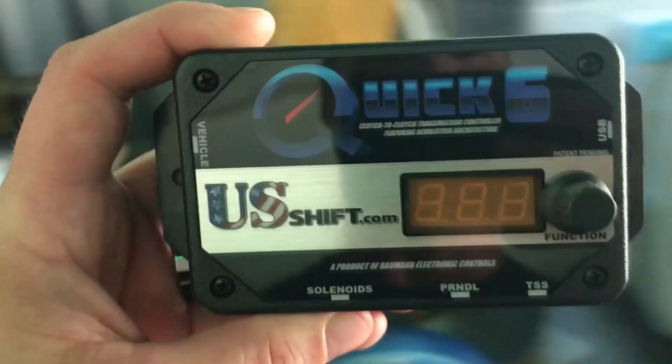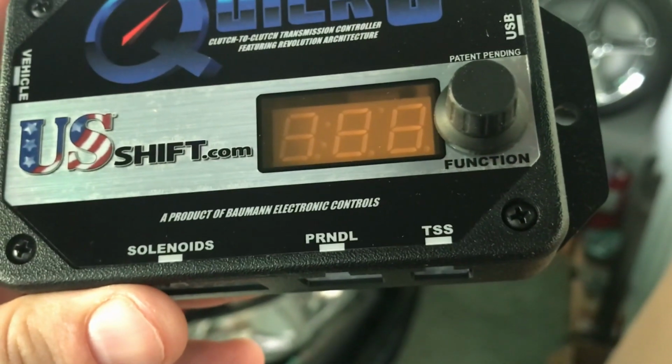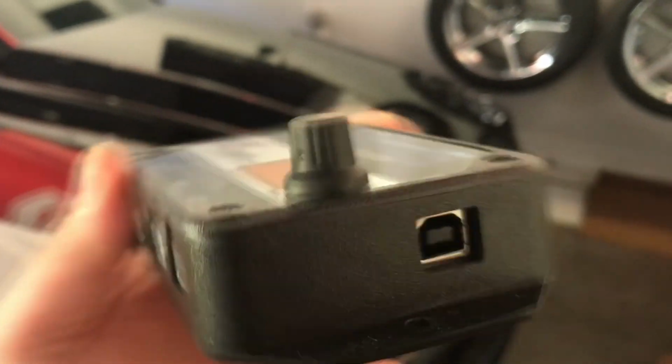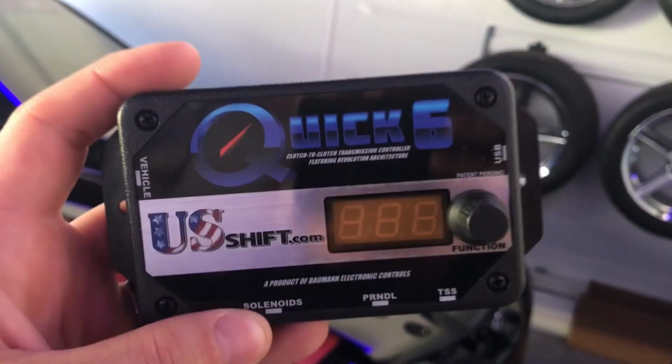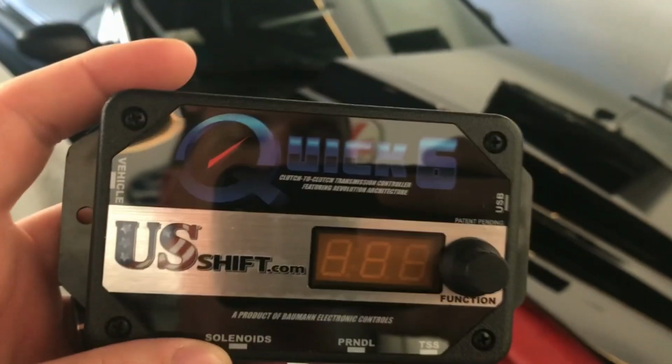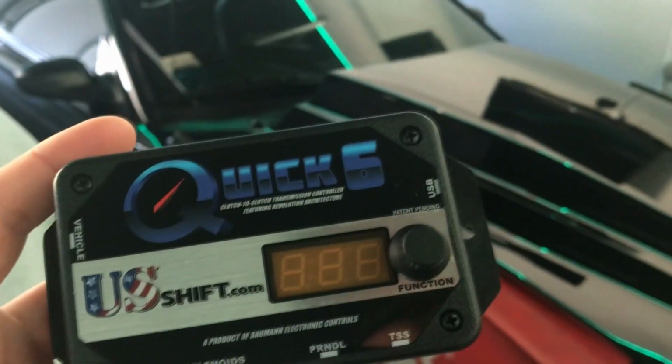So the nice thing is it was easy as just taking it out, unplugging it, putting it in a box, and there it is. But this is what does all the magic, making a 6R80 work in your car. So that's where it plugs in for your solenoids, your linkage from your shifter. This is where I plug in with my laptop to actually make changes to it. But yeah, now I'll plug it in, make sure my settings are still there from before. And then, yeah, we'll move on to the next video that talks about the intake manifold.